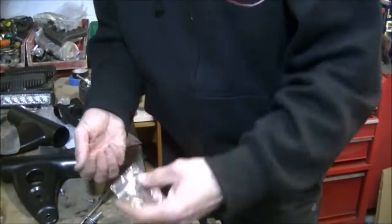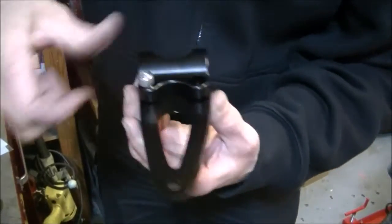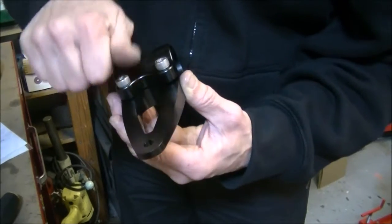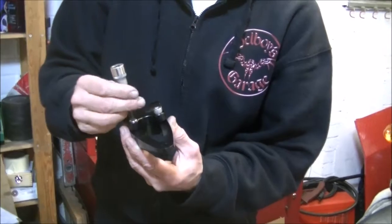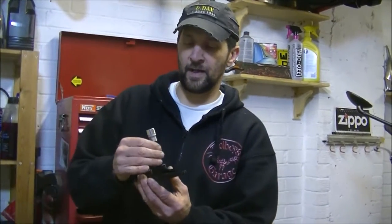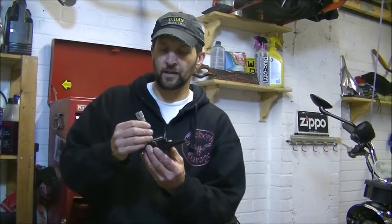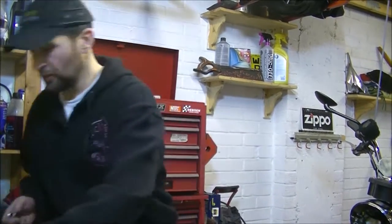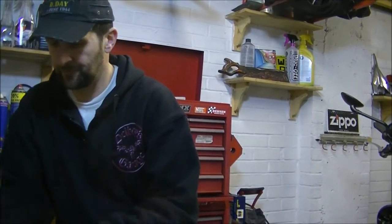Okay, and before you put them in, on the inside, just pre-install the little bolts there. Now I would not put any Loctite on them. I don't think you need to. If your bike is going to get wet and dirty and filthy and you're going to use it in all the weather, I'd possibly put, at the very best, a little bit of copper slip on there, just to stop that steel to alloy corrosion that occurs. But to be honest, they're absolutely fine to go in just like that. Just pre-install them so you haven't got to reach around the inside when you're fitting them.